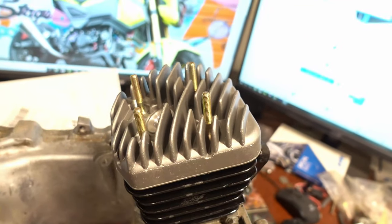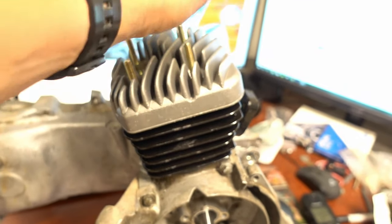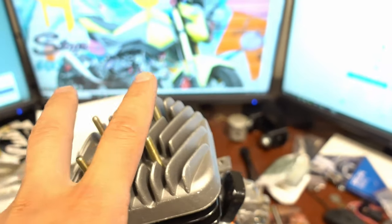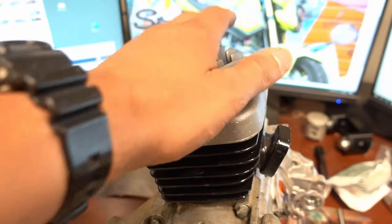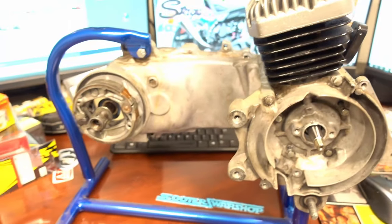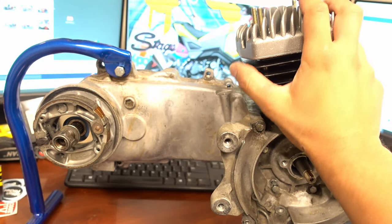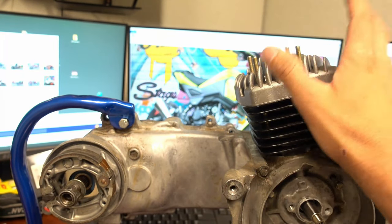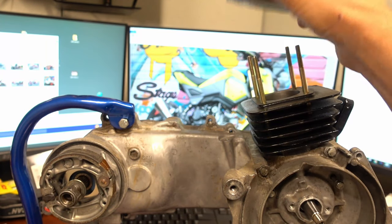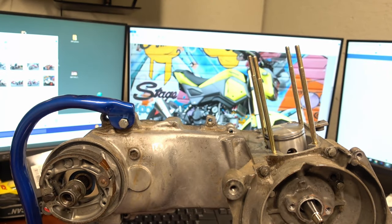You're left with your studs — these are stroker studs. Drop your four nuts on there, and depending on what bike you're doing, look at the OEM manufacturer specifications for the torque. It's good to use threadlocker on these — I always use threadlocker on the studs and on the nuts as well to make sure it doesn't come off since there's a lot of vibration. Hopefully that helps show you guys how to install a big bore kit. This is going to be the same theory for a Zuma, a Jog, a Chinese Minarelli, Honda Elite, Honda Spree — all the same. Studs are nice because you can just slide everything over, and it's just four bolts to take this top end off. Thank you for watching — you guys have any questions, let us know.